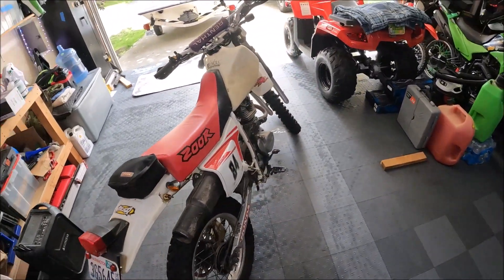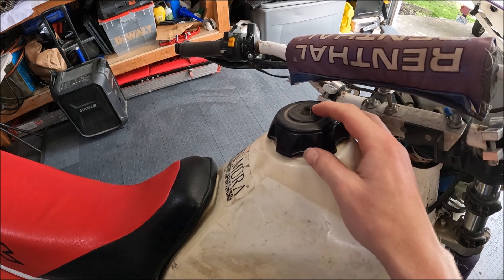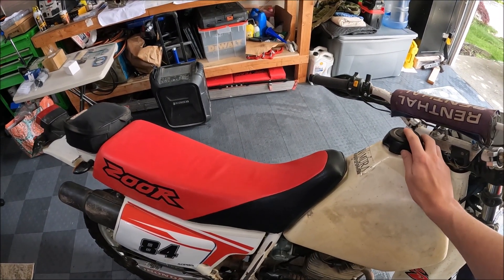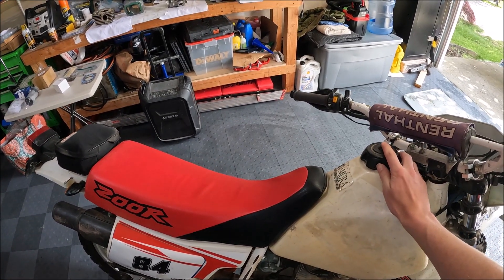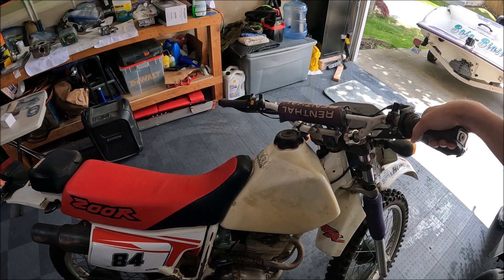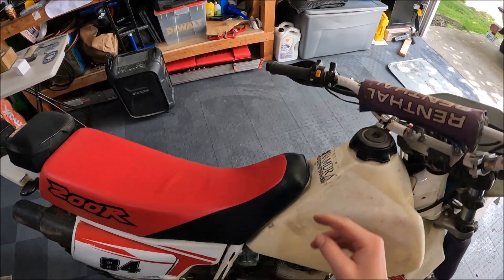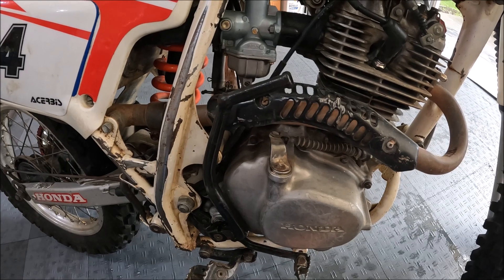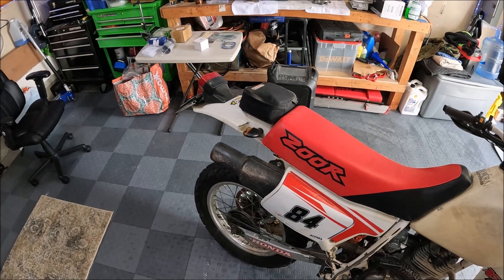I think the problem is I left it outside that night and I don't have a fuel valve, so I'm thinking it got just enough water in the fuel. I'd be riding along, hit a bump, and it would start bogging — you'd kind of feather the throttle enough to keep it alive and it would go away. At one point out there it died on me and I actually emptied the bowl by loosening the bowl screw and it started right up, so I think that was more the problem. But I have the means to just put another top end on it, so I'm going to do that.